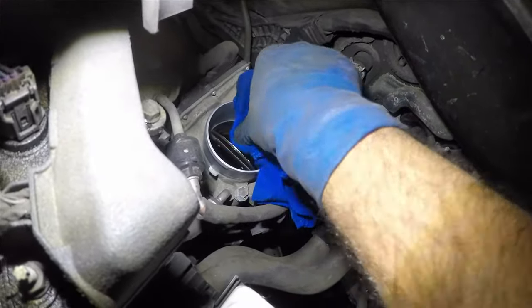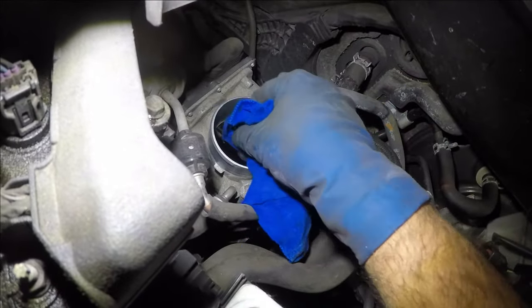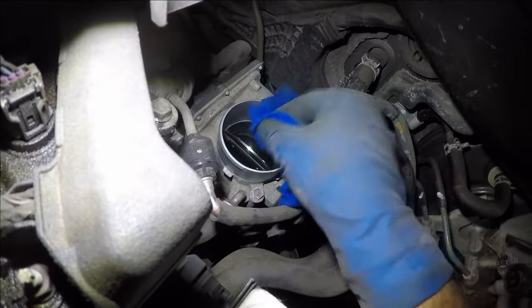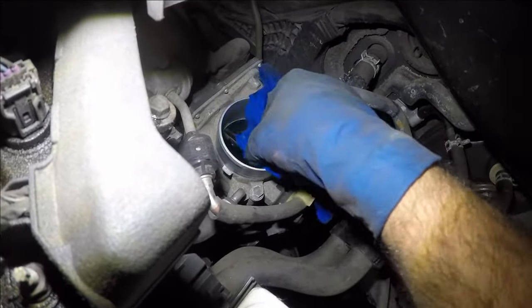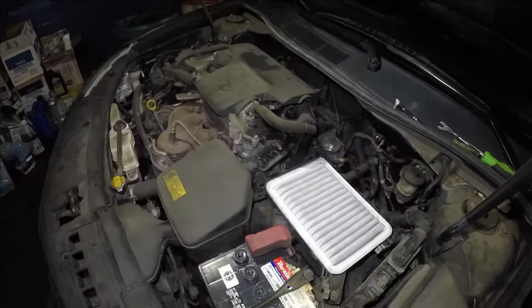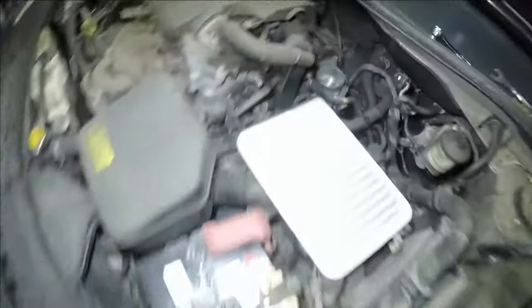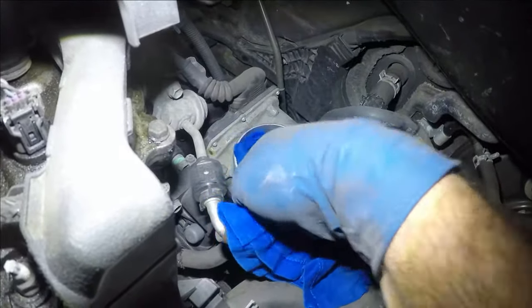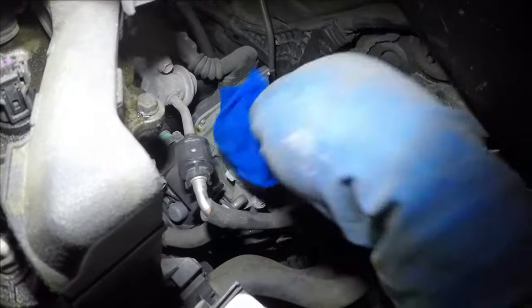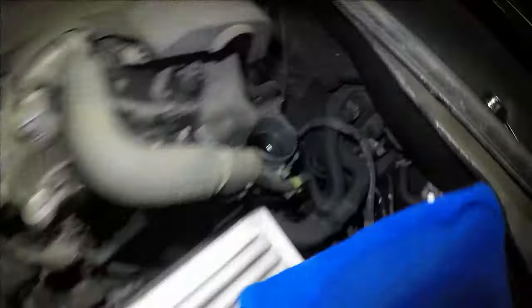If you're still having bad or low idle after this, you could replace your throttle body, but it's gonna be an expensive job. So we got one side done, and I also recommend you clean the flap here. The bottom side faces down — you don't need to mess with that. Let's clean the flap here. Let the throttle body rest a little bit. Meanwhile, I'll grab another rag and do it one more time — let's soak this up really good. Now I'm gonna do the inner edge on the opposite side. See all that stuff coming out? That's all the buildup — that's what's causing the low RPM and choke up.